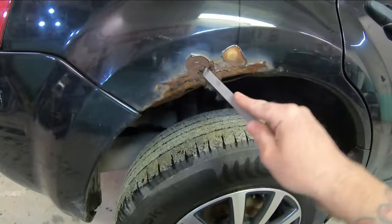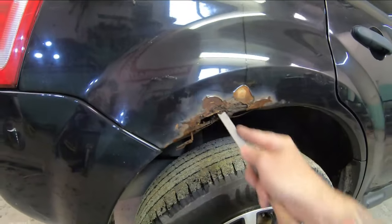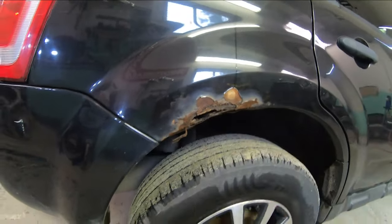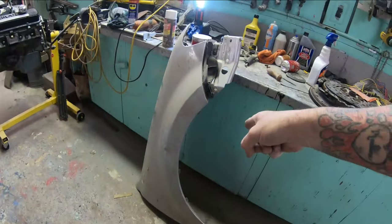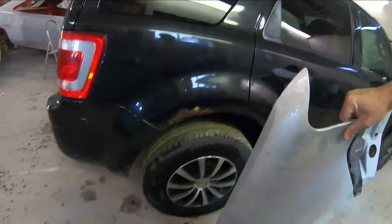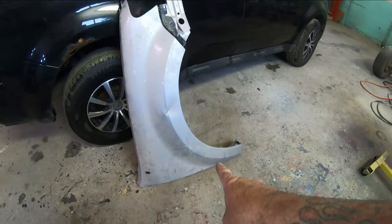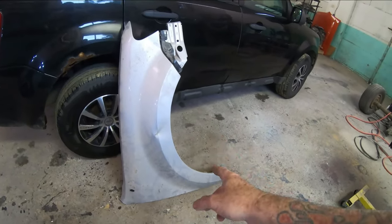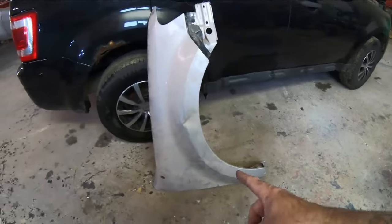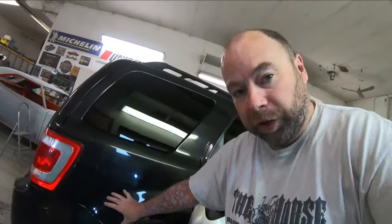In this case she's pretty rotten — there's not much left there. You can see the inner is rotten out too. But what we're gonna be doing here — I just happen to have a damaged right front fender for a Ford Escape in my stash parts. If you're doing this, because you can't get this panel, you might want to just buy an aftermarket fender, which is something I have done for cars in the past. Just buy a $100, $200 fender and then you just make your patch out of it. Better option — go to the auto wreckers. If they've got a rust-free quarter panel, they're not gonna want to just cut a piece out of it for you. They're gonna want to cut off the entire quarter panel and sell you that.